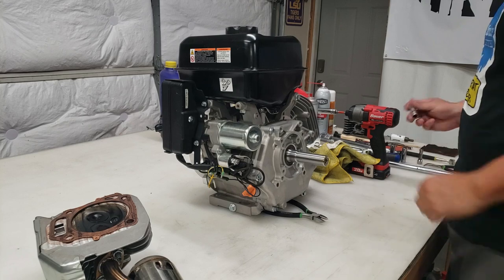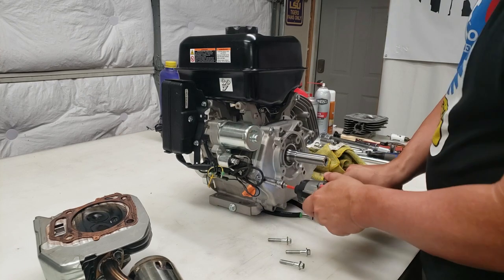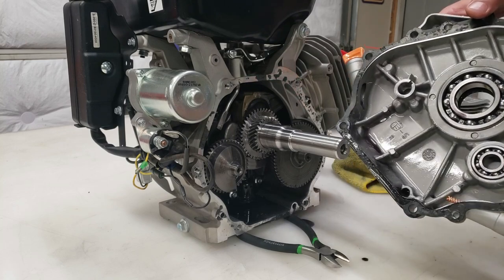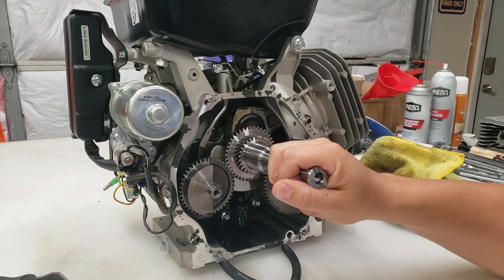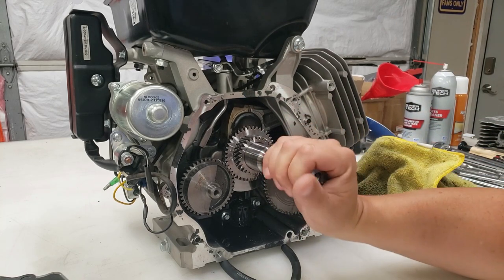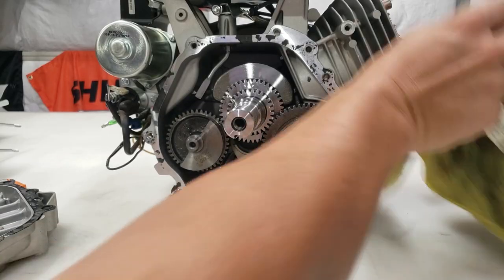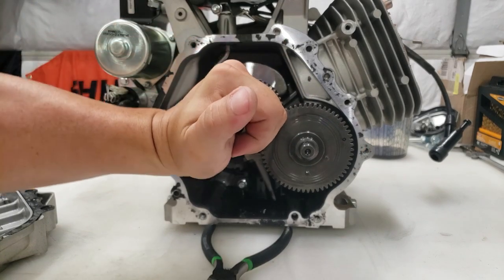Push rods aren't mushroomed out, they look okay. Looks like the lifters are okay as far as I can see. I see lots more shiny bits down in the cover here. Governor gear seems okay. I think I found the problem right there — the rod cap is either broken or something isn't right. It looks like the bolt backed out right in here, and that's probably what all this chunky mess is — the bearing material ate all the pieces from slapping up against the crankshaft.